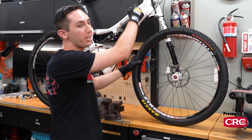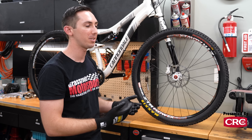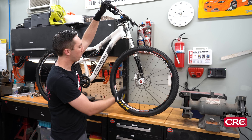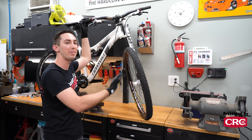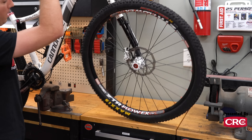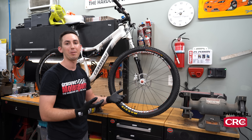Caster isn't about which way the bike is leaned over — caster refers to this angle. On a bicycle it's the head tube angle; on a car we call it caster, and it's basically how far reclined the axis of the steering pivot is. It has two positive benefits on a track car: first, it has a centering effect just like a shopping cart or a bicycle — this angle is why you can ride a bike with no hands. And when you steer with the bike upright, you can see negative camber appearing from that head tube angle. By adding more caster — simulated here by dropping the back of the bicycle down — when you turn, you get more negative camber. So we're going to put camber and caster plates on the GTI: one part that adds more negative camber and more caster, creating much more dynamic camber when you're in the middle of a corner.